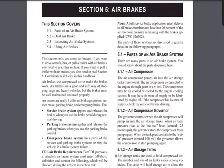The truck still won't roll anywhere. It can be parked on a hill without the wheels being chocked and it won't move. That's because the spring brake system is holding the trailer from rolling. The spring brake system works automatically — air goes into the system and retracts the spring so the brakes can release, so the pad lining can release off the drum and cause that drum to have rotation. So air allows you to move.